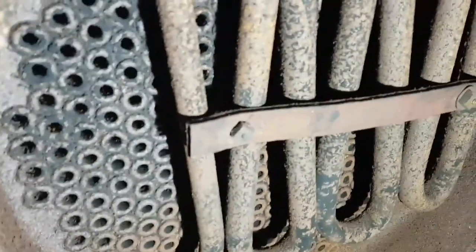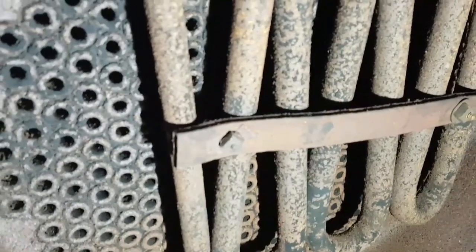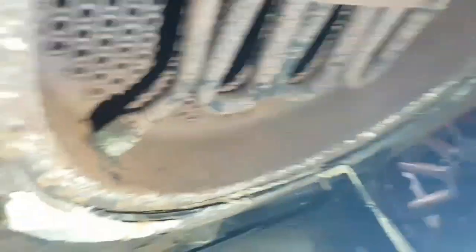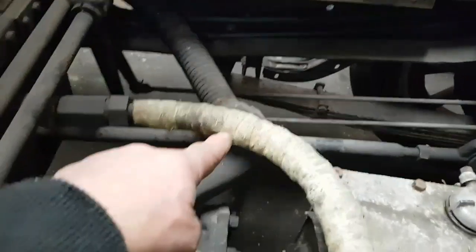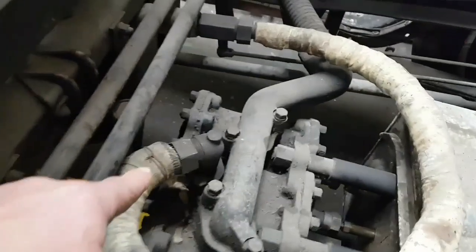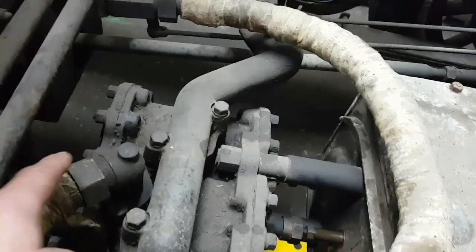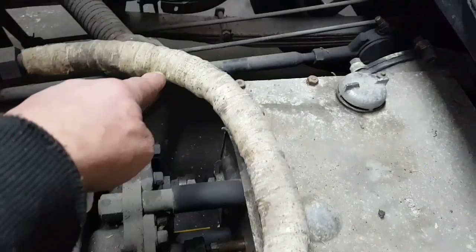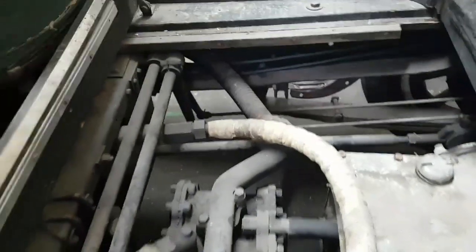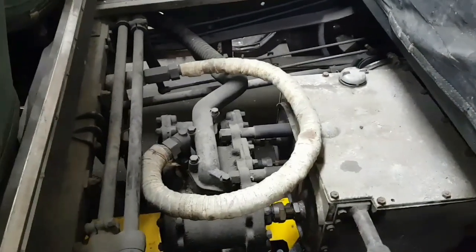I can feel air coming out from somewhere - one or more of those tubes has corroded through and is letting the air escape. Once the steam has been through the superheater, it comes to the back of the car, following round to what I'd describe as a valve chest, allowing the steam into the cylinders. Once the steam has been used, it comes back out through the exhaust and up to the front of the car to a condenser, which is where the radiator would be on an internal combustion engine car.